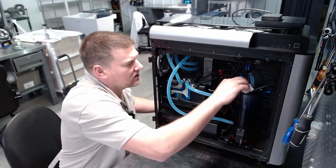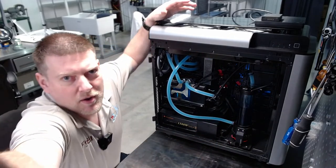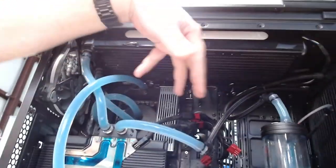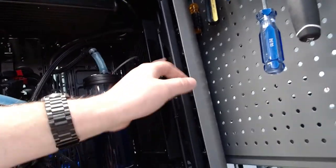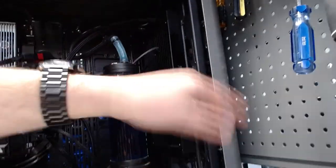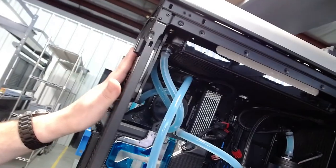Okay, so besides the dust down, I've got a radiator up here, and I've got a radiator right here on the front. Here, let me bring you guys down and show you what I'm talking about. So you can see the radiator in the ceiling. That's for those exhaust fans, so it's helping to pull all the air up. And these ones here are the intake fans. So you can see I've got air that can bypass the radiator. This one is not really necessary, but every little bit helps. So I've got my two fans. They're gonna blow a lot of air past the radiator, but some of it will get through. And then the air is gonna come down in here, and I've got my exhaust radiator, and I have an exhaust right here on the back of the case.